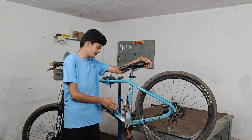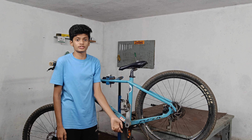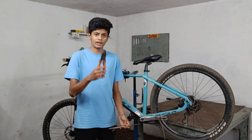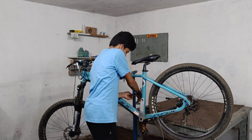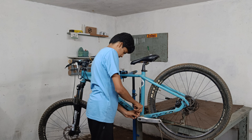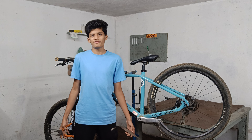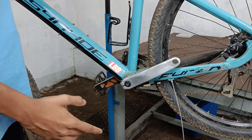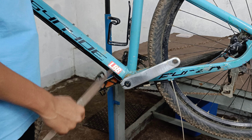The crank is a little bit twisted and also bent inside. To remove the crank arm, we'll need a plier and a metal file without its handle — you'll know why we need these. Now it's time for a hack. To remove this end cap, which in my case is rounded up — and most probably it's rounded up for everyone — there are no Allen key screws anymore.